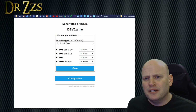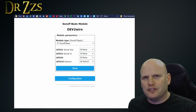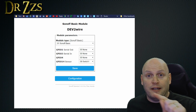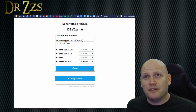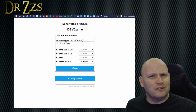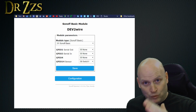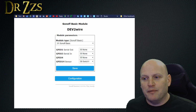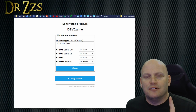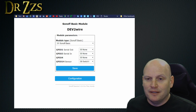The other reason that I had stopped, I was ready to do it, and then there were some issues with what kind of wiring your fan has, and if it's US versus some other places, there may be some differences. And some people were having trouble where it's supposed to control the speed of the fan, give you 3 options for speed. But depending on some resistor locations in your fan, instead of fast, medium, and slow, you may end up with slow, slower, and really freaking slow. And so I haven't done the fan flashing, the fan 2 module yet, because it sounds like it's going to take some time, and I haven't had much.